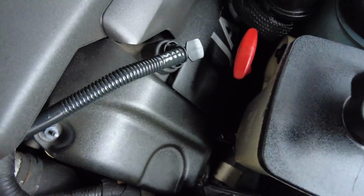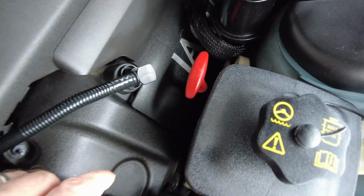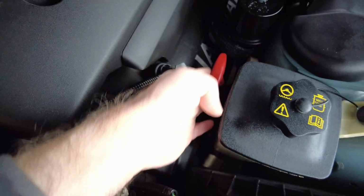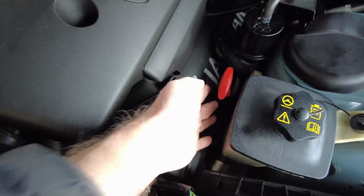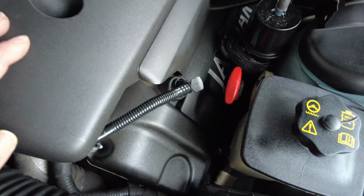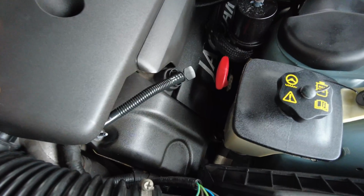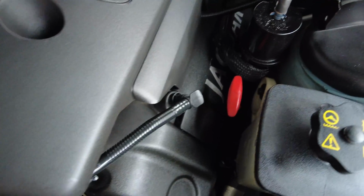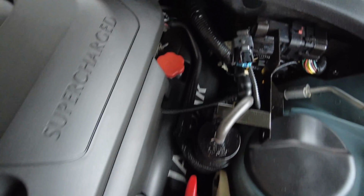Oh, and also this dipstick here is going to be quite problematic, I think. There should be a technique whereby I can get to the 7mm retaining bolt, which enables a bit of movement there, but I think actually what I'm going to try and do is just relieve the dipstick. I'll keep it in its tube, but just try and relieve the tube by pulling it up towards me, and if I can just get enough clearance over the bolt there, then I should be good just to move that out of the way. If that doesn't work, then I think I'm looking at trying to bend the clip on the dipstick tube to get it free over the holder that it usually attaches to. Once I've done that, I should be able to remove this coil cover.